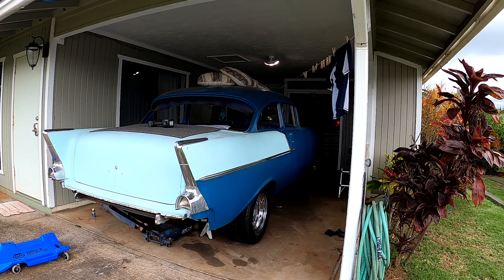One other thing I didn't think of until just now — when I put the front disc brake on, I never set up the toe on this car, so it's toed in pretty far. Like three-quarters of an inch or more, I'm betting. Before I can roll it outside and look at it properly, that has got to be addressed.